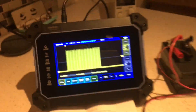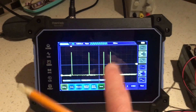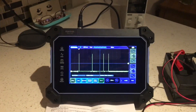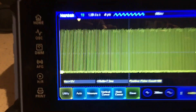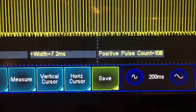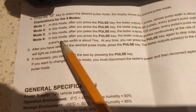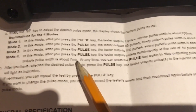Let me show you the last mode — Mode 4. Remove the power again; expect the random pulse, and remember that it could trigger your injectors momentarily, throwing off your balance test. Mode 4 is continuous, so we should see a continuous pulse train across the screen. It just fills the screen. The pulse count is probably a function of the time base. The pulse width is 7.2 milliseconds — Mode 4 is continuous pulses, and the manual says about 7 milliseconds, so that makes sense.